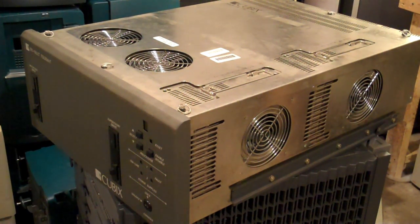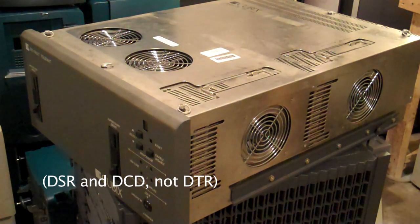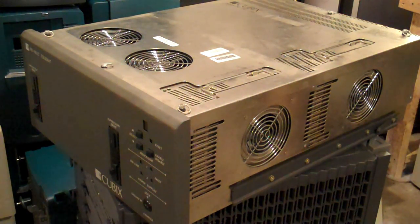The machines were standalone and could be hot-swapped. These machines were designed primarily for remote access stations. Usually what you would have is a modem bank sitting behind this, and each of the SBCs would be hooked to a single modem. They would run a Novell or other networked DOS system and be running something like PC Anywhere. This function is readily apparent because the supervisor is capable of resetting boards if it drops DTR or DCD. So if the modem drops and something funny happens, it loses connectivity to the modem — it has the option to actually reset the computer itself. That makes it pretty obvious how coupled they were to the serial lines.